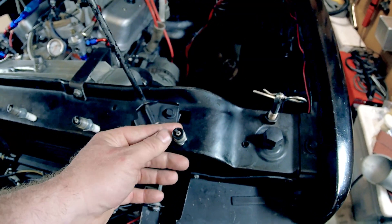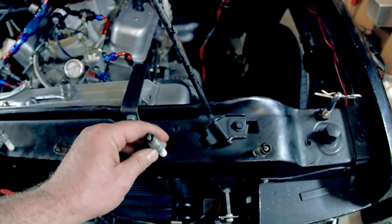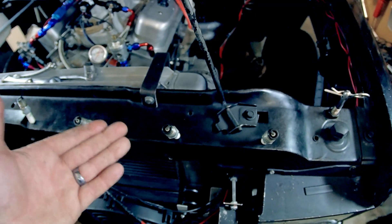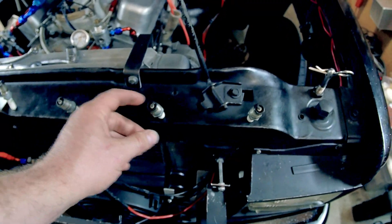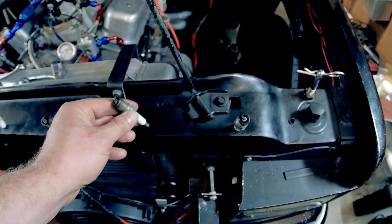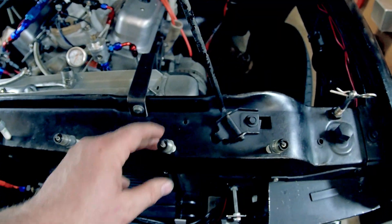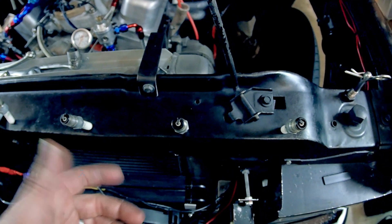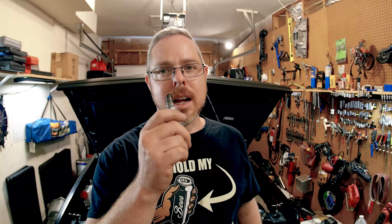Mine does burn a little bit of oil so it'll probably be darker than most, but people take plugs like this — and I can tell just by looking at this that you've had this plug in for a long time. You've run it up and down the street, it's been in there for months, and then you pull a plug out and ask 'how does my tune-up look?' That is not how you read plugs. You cannot read plugs that have been in there for about a month and determine your tune. The only information you're going to get from a plug like this is how your idle air-fuel mixture looks.